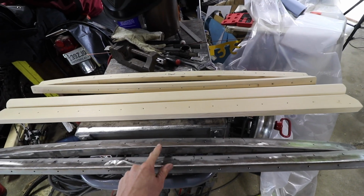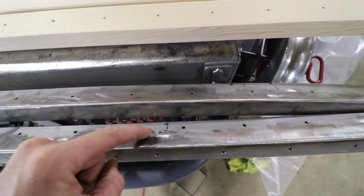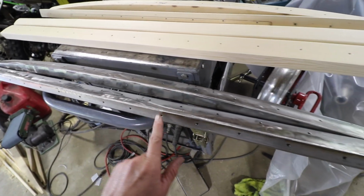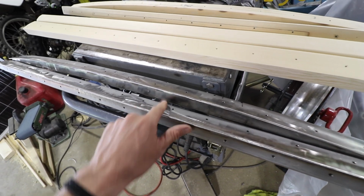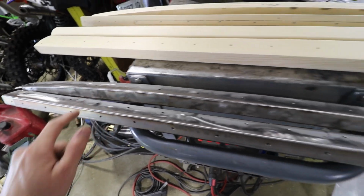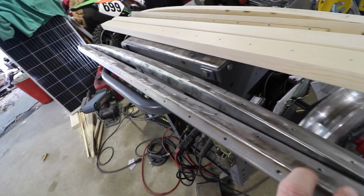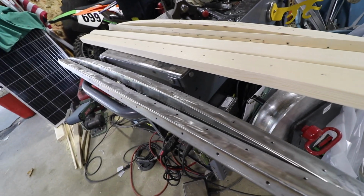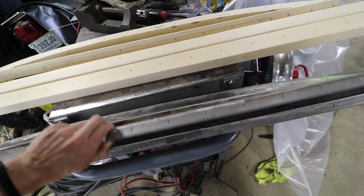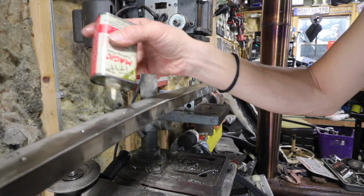So in the end, I am going to sandblast these, and that will leave me with a matte finish. It probably will look like that. It'll also hide any high spots or low spots because I ground all these corners and made them super soft, like radiused them all off. And I'm sure there's high spots and low spots, and I welded all these, so it's not perfect. But if you sandblast it, it'll leave a matte finish, and it's harder to tell because it's not shiny. And sandblasted stainless just looks good. So yeah, I'm gonna do that. I'm gonna countersink these and I'll get these things on.